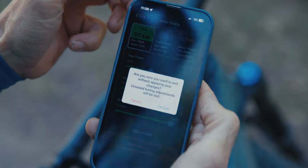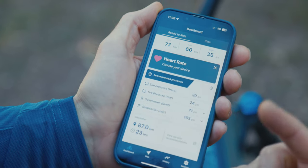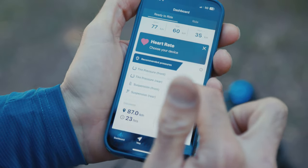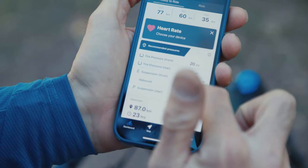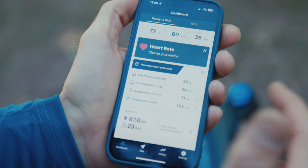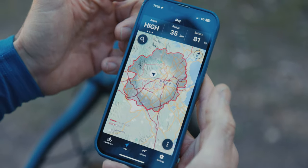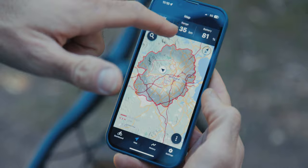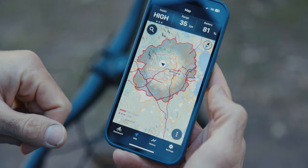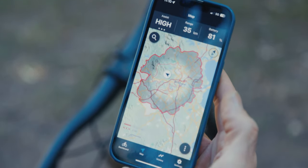Because it's the Trek Central app, you can also get setup suggestions. I entered my height and riding weight when I set it up, so it'll give me tire pressures, shock pressure, and feedback on rebound damping — good baselines to start from. I'd recommend noting those and seeing if you need to change them for your own settings. With the navigation function you can even get a visual look at the range you've got left and where it can take you — I can see I could just about get out of Brisbane on the current charge in high assistance mode, though obviously this changes wherever you are.